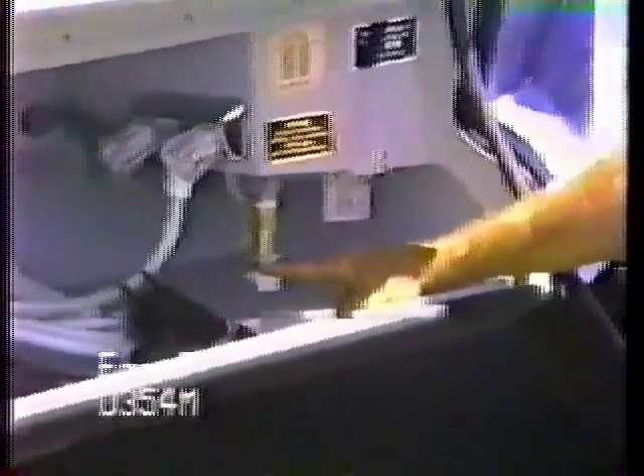This is the city water connection. If you're stopped and going to stay a couple days and want to take a long shower, you're going to undo the little cap right here, take the water hose, slide it in under here, and attach it on. This will be your city water connection — it will allow pressure from the water to run the shower, the toilet, the sink. Otherwise you would be turning on your water pump.